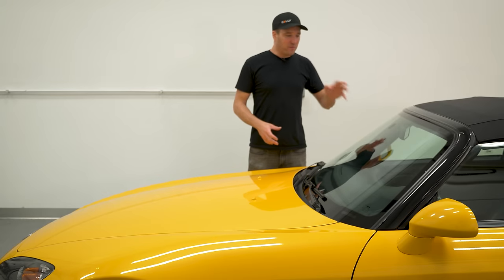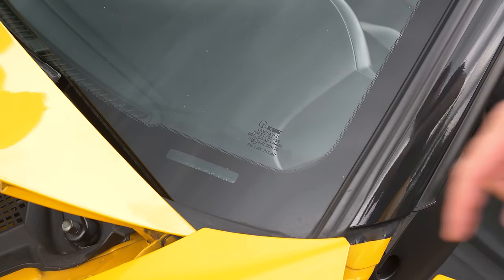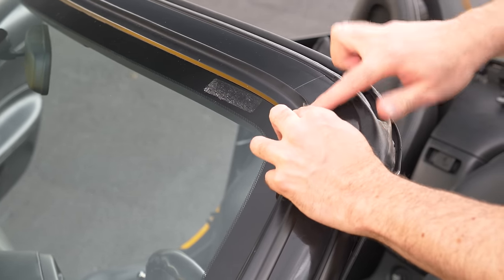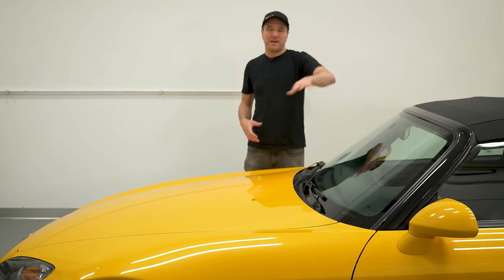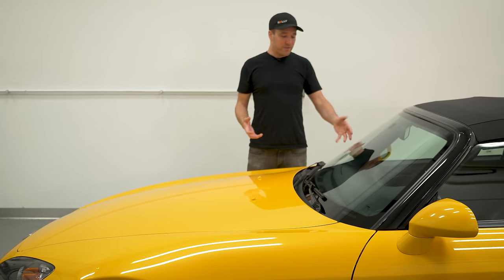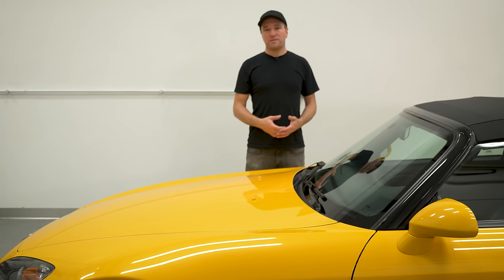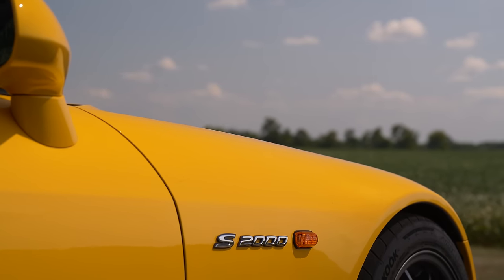One of the last exterior things to look at is the windshield — it's really common to have these replaced. In the bottom left you can see if it doesn't say Honda; it might say PPG or another brand. Check the weather stripping or rubber seal along the windshield: is it bubbling up, coming off, or defective? Also look for adhesive marks or stickers near the passenger or driver side at the top — if someone's done a track day or autocross, they'll put stickers or decals on your windshield for run numbers. Look for suction cup residue on the inside of the glass too; a ton of them likely means a camera or GPS module for track timing. The whole point is to ask the seller — if they won't disclose this stuff, it's a pretty big red flag.